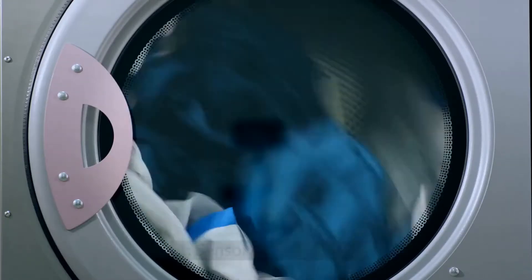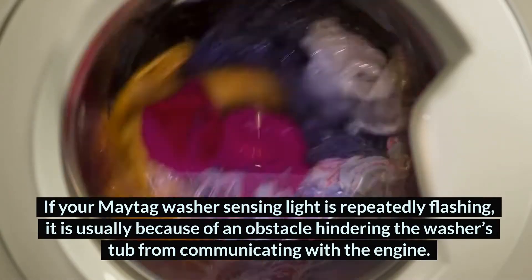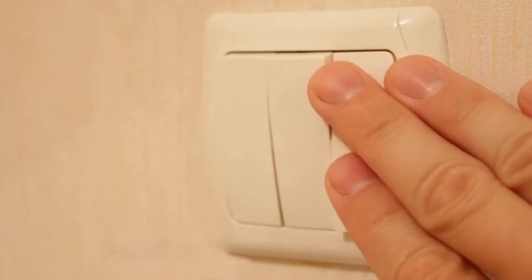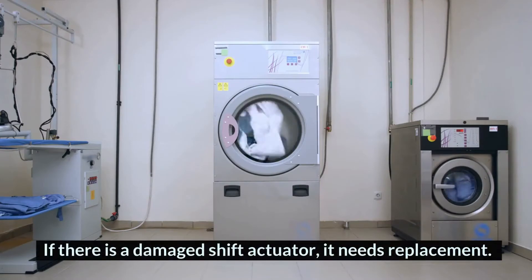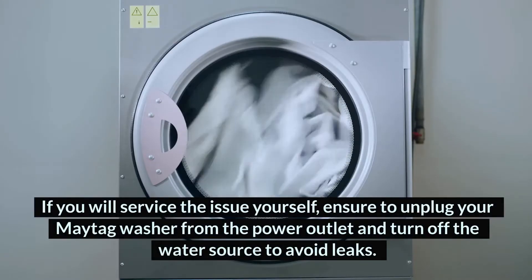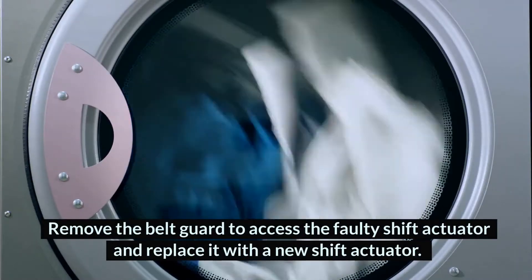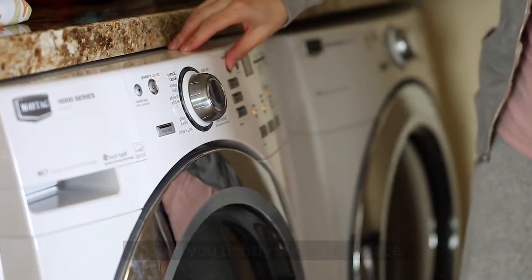1. Sensor Light Flashing: If your Maytag washer sensing light is repeatedly flashing, it is usually because of an obstacle hindering the washer's tub from communicating with the engine. Another likely cause is the shift actuator, which controls the transmission part of the washer. If there is a damaged shift actuator, it needs replacement. Ensure to unplug your Maytag washer from the power outlet and turn off the water source to avoid leaks. Remove the belt guard to access the faulty shift actuator and replace it with a new one. Ensure you tightly screw it in place.